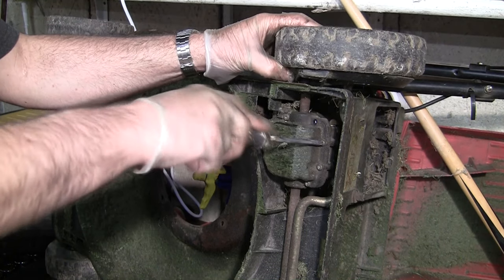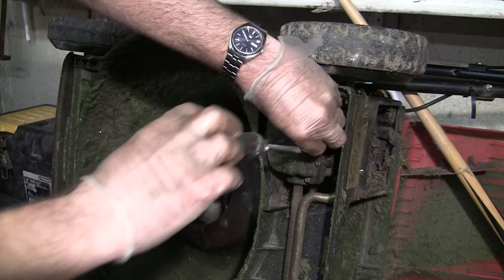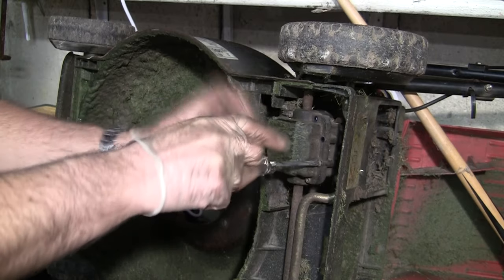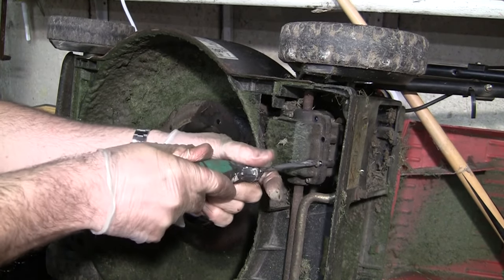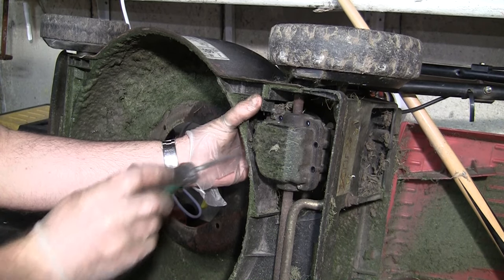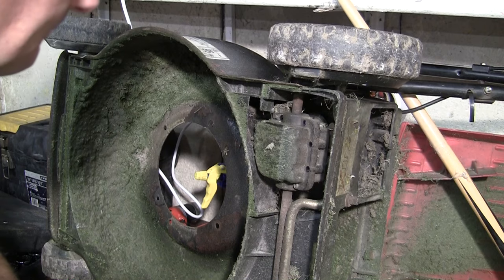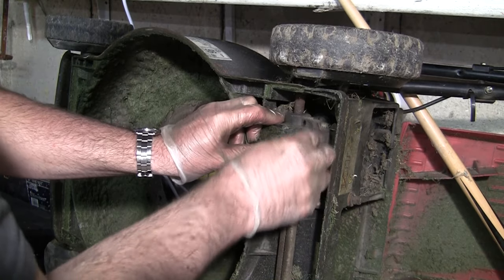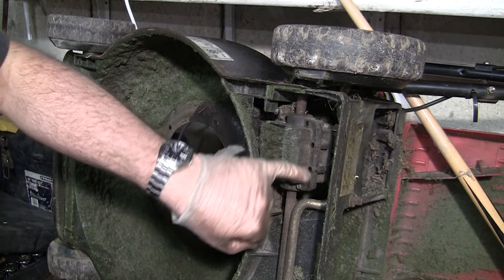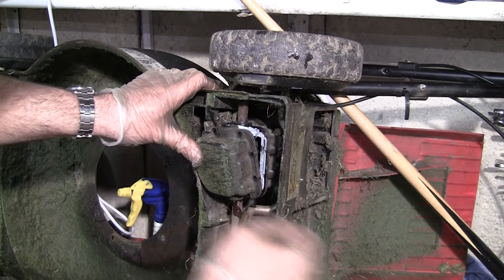Some of these transmission boxes have got metal or aluminium parts all the way through them, and some are mostly plastic — those tend to break the most. The aluminium ones with the plastic worm gear can work okay even after 15 years. I'll fast-forward while I take these screws out. Once the screws are out you'll need to prise this apart — it splits in two. You may want to use a bit of gasket sealant to put it back together and add a bit of transmission oil back in the box if you do this.